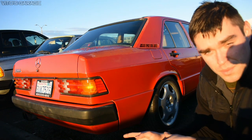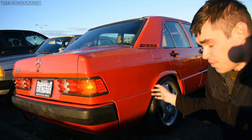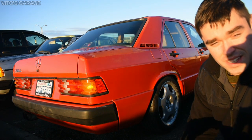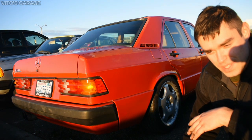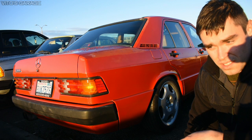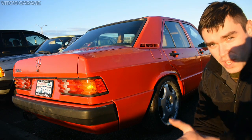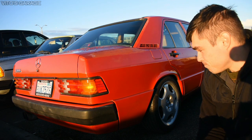In this video I'll be replacing the idler arm on this 1991 Mercedes 190E. The idler arm is bad — the right front wheel has play when you move it at the three and nine o'clock position, so it's loose and it's a safety issue. You will see that I ran into a problem when trying to replace it. This may also apply to the W140 or W124. Keep watching — let's save classic Mercedes, let's save classic cars.